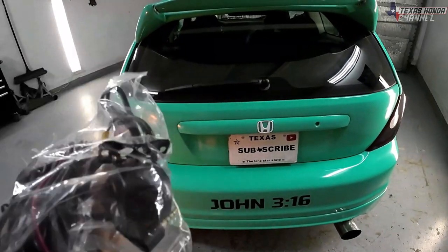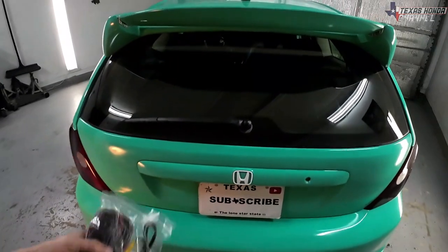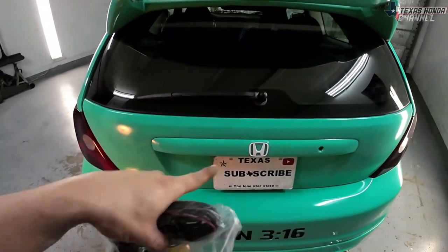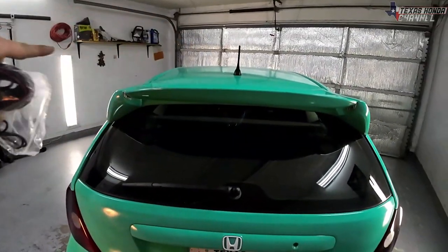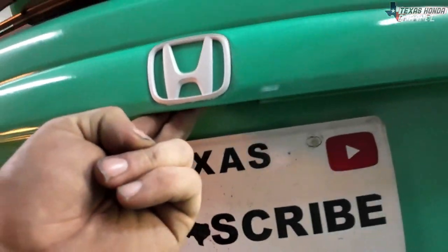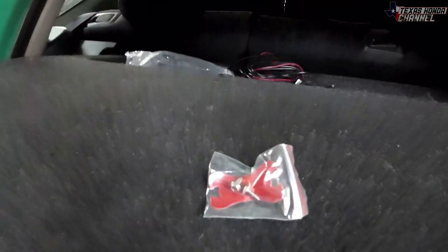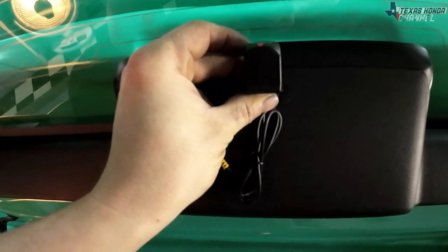One of the first things I like to do is figure out where I'm going to be putting the backup cam or rear dash cam on the car. Some people locate them on the inside so that way water spots and stuff like that don't get on the lens and obscure the vision. Most of the time I put it on the outside, then find a grommet that goes into the car, tap into that grommet hole, and run the wires up through the very top of the headliner. On this particular car I would typically go right here, but that is where the release is for the hatch and it would look tacky off to the left or right. So I'm going to go on the inside. We can easily install the hardware that it came with there and drill a small hole to tuck the wire through to make it look clean, then route all this up to the headliner.